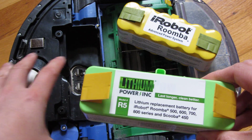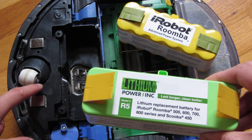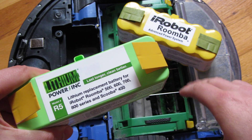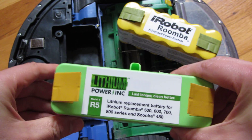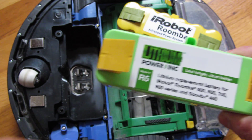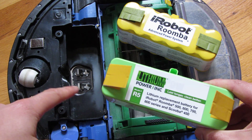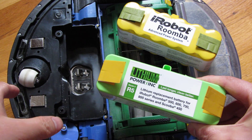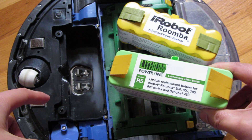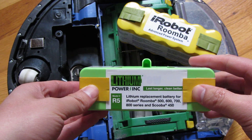Some people might think it'll clean four straight hours — that's not true, and that's more about the Roomba's cleaning cycle than the battery. Another thing: after two hours, the Roomba light on top will actually glow amber, and you'd think the battery is running out. But with this lithium battery, it actually has another two hours of charge remaining. So you're basically going to ignore the Roomba's lights. It starts green, goes amber at two hours, but still has two hours left. This battery is more advantageous for people who run the Roomba manually rather than on a schedule.